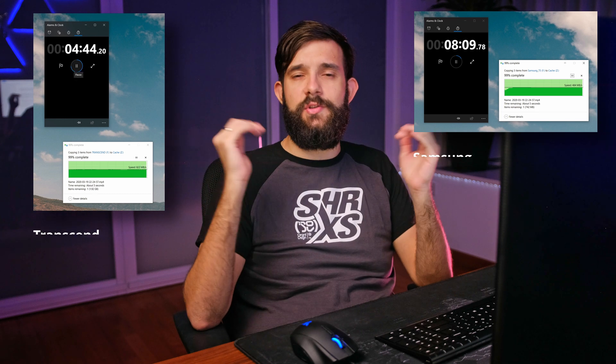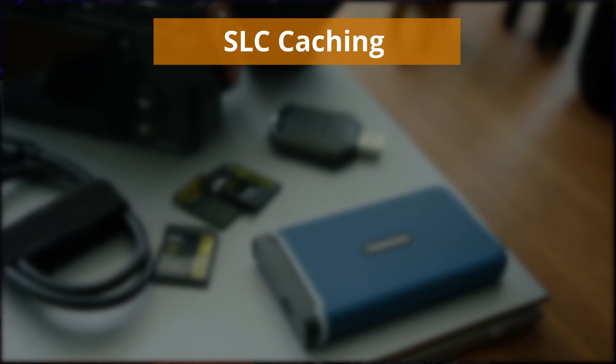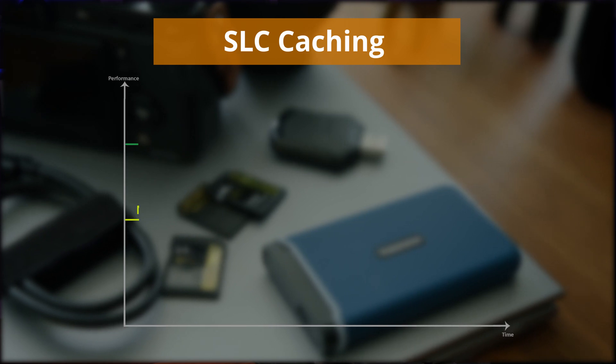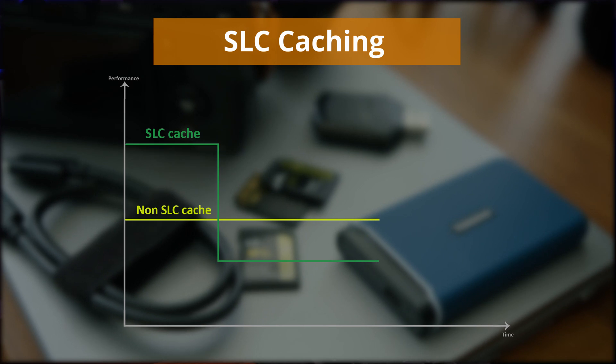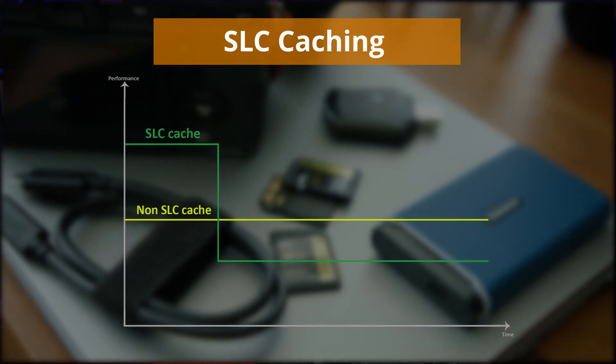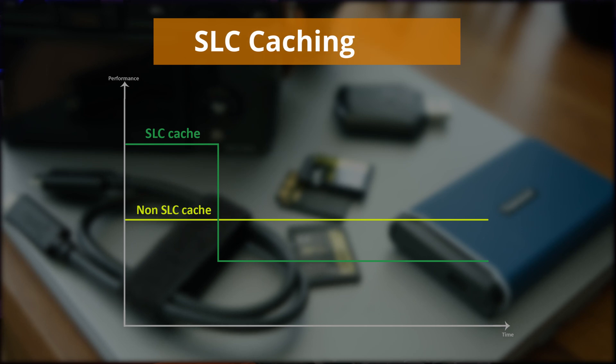This had me scratching my head. It seems many SSD manufacturers boost speed by introducing an SLC cache buffer, which provides a dynamic portion of the drive at full speed. Providing you stay within that rated capacity, you'll always have great performance. The flip side: if you have one large transfer, the buffer runs out and you choke the drive, hence the slow write speeds. But after the transfer finishes and you leave the drive for a while, it reshuffles data and the cache becomes available again.